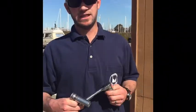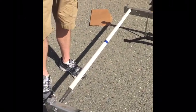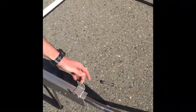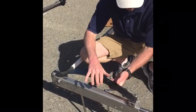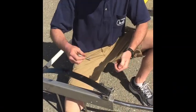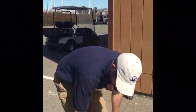This part is installing the leaf springs: 2 3/4-inch sockets, spring, nut, and a bolt on either side. They go through here. As you can see, there's holes for them. So you take the spring, insert it through there, other side through there. I always put the nuts on the inside of the trailer. Like that, and the axle slides on.